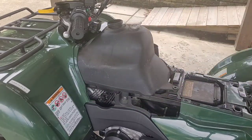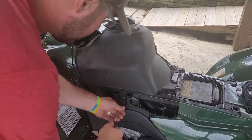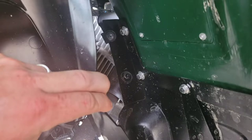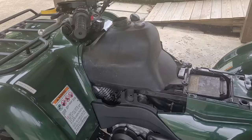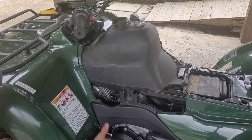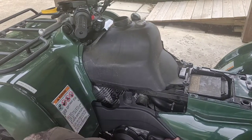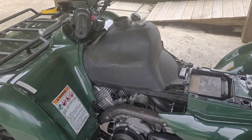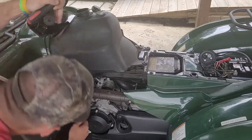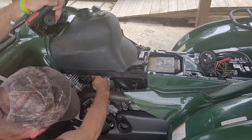This quad is like brand new — the air filter is perfectly fine. We are going to put a new spark plug in it as well; I just didn't get one yet today. Now these plastic pieces, as you can see right here on the inner fender, make sure you find those because they are kind of hidden. You've got to move it out of the way — there are two Phillips heads, one way back down below and another little screw you've got to get out. It's kind of a pain. Either way, get that out and you can see the carb and start seeing the fuel line. Pretty easy to get at now.